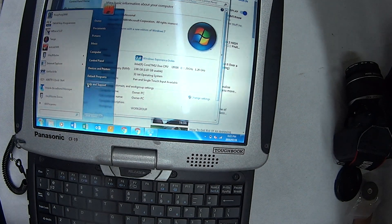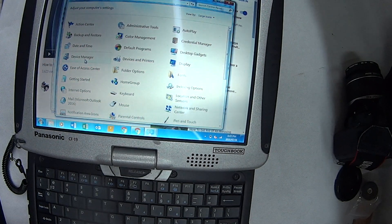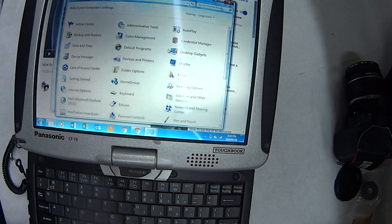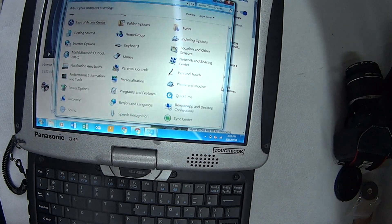The hotkeys is where it's all at. Go into Control Panel, then Device Manager. Under Sound, I was noticing that I only have SoundMax Integrated Digital HD Audio. I uninstalled that, and as soon as I powered back up it found it again — so you might have the same one in there. If not, you can download it from Panasonic's website.